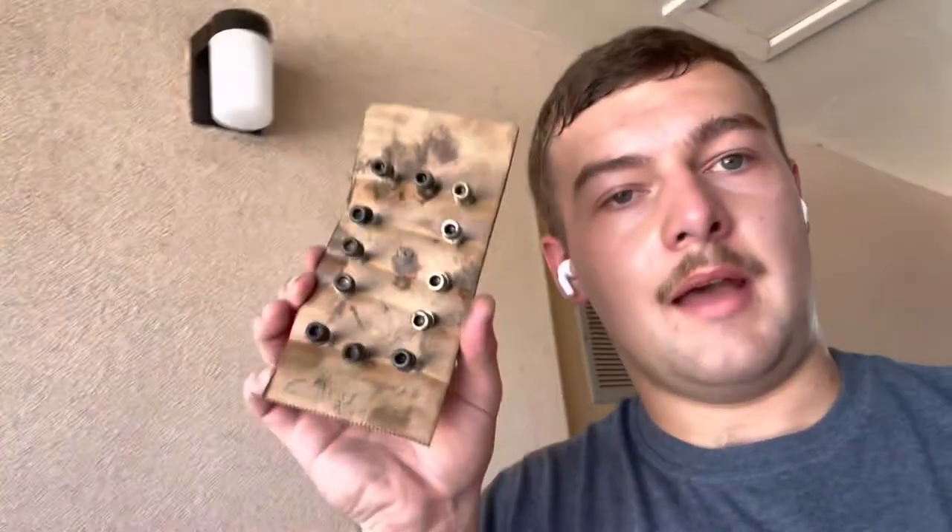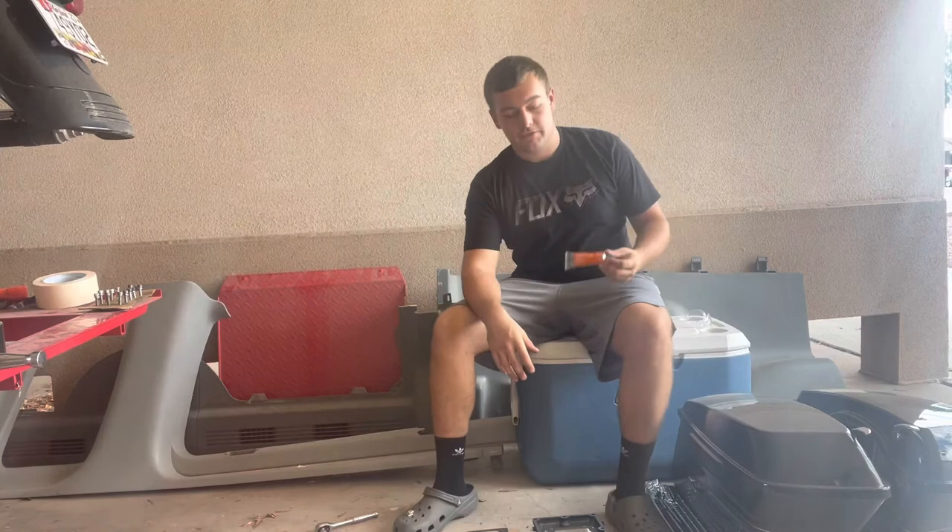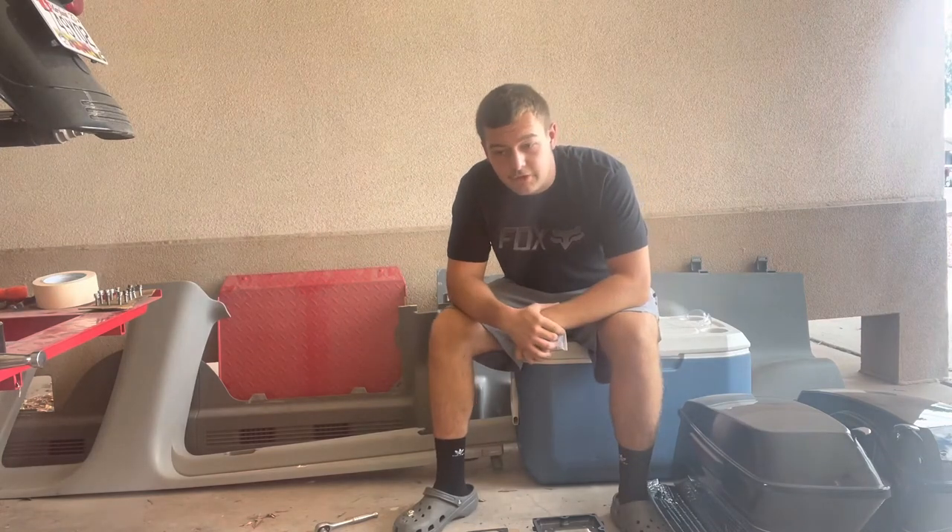A fancy little trick I like to use when pulling off pans, plates, and covers: I make one of these out of cardboard. The top says 'front,' the bottom says 'rear,' and sometimes I'll trace a little outline so you know where each bolt goes. For example on the primary, the bolts are different lengths and go in certain holes — this keeps you from getting all mixed up.